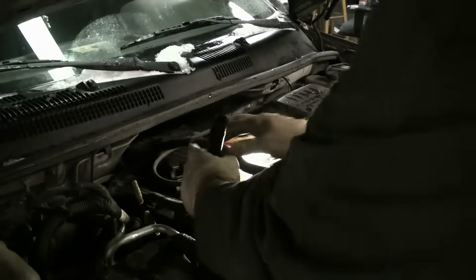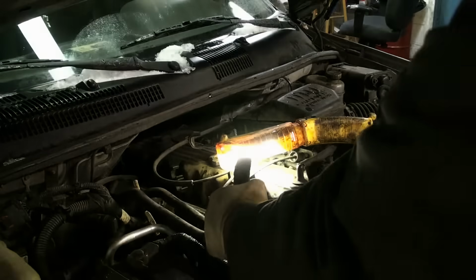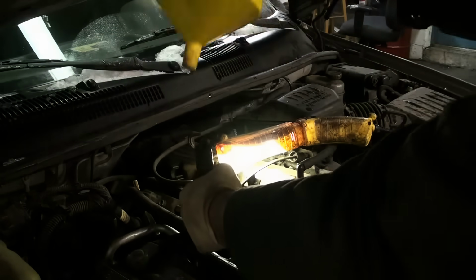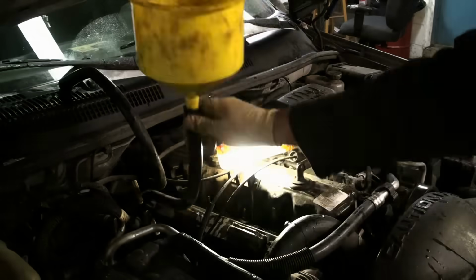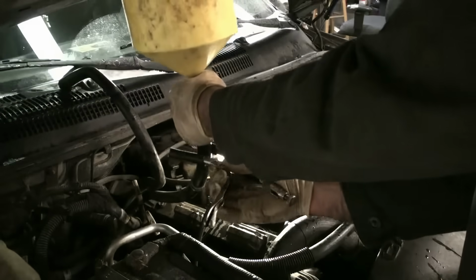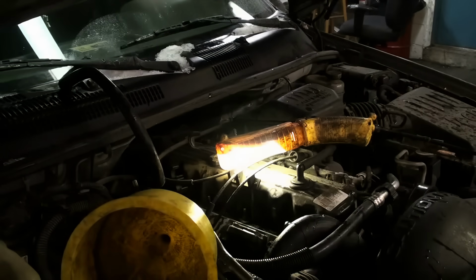We want to make sure that we're higher than our core with both hoses, and I'm going to pour into the out. I have this nice funnel. I'm going to loop this one up underneath the windshield washer wiper, and I'm going to pour my product right into here. To make sure that this doesn't regurgitate, I'm going to use those same pliers I used on that air hose and just let that fester. Move on to the thermostat.